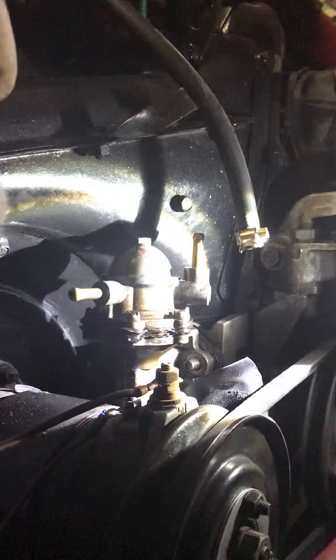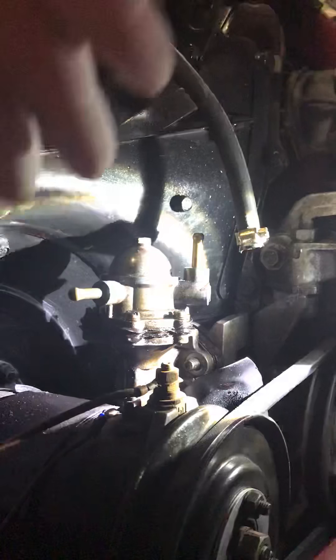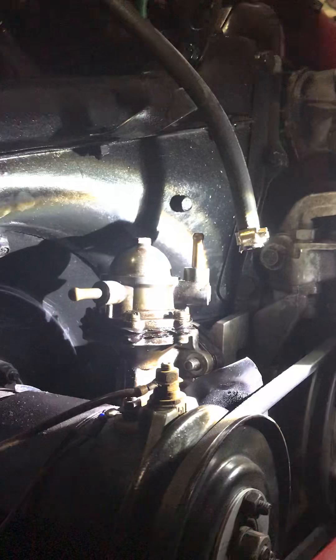Be aware that you will have petrol sitting inside the pump, so even just using a rag or placing a tray underneath is a good idea. Take your own advice there — get one and just loosen that other nut.